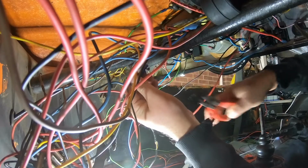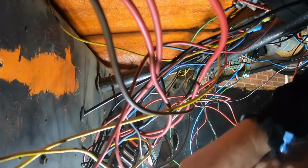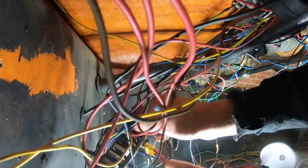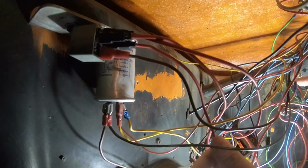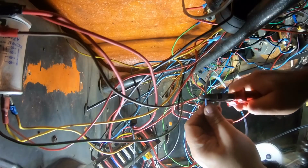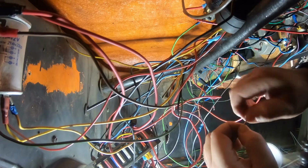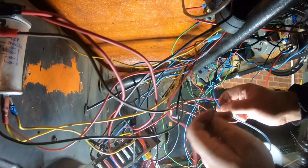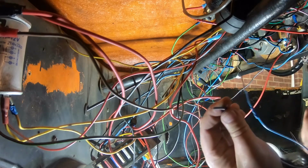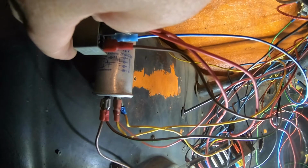Blue and red, snip. It's a little bit tricky doing this on your back, lying upside down. So this is the wire that I cut originally that went from blue and red to blue. I'm now going to replace it on the bottom of the fuse box here. Being no auto electrician, blue and white into red doesn't make me happy, so that's going to change. In case you're wondering, I have matched the size of the wires coming out of the steering column. I've got the same ones because I found a lot of wires where it goes from thick to thin to thick to thin. I just want to make sure that they're correct. There we go. Now we've got blue and white the whole way through. Oh, it makes me happy.